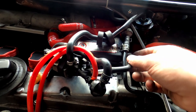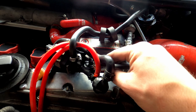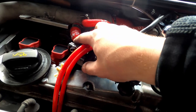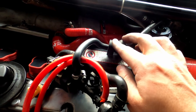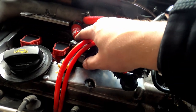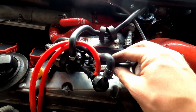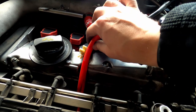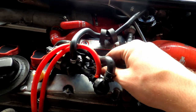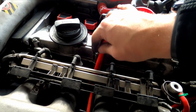If your vacuum leak here is sizable, you'll also consistently have a lower idle vacuum reading. That reading may jump around a bit depending on how small the leak is. The TT has an N249 system which contains a vacuum reservoir — it's this little black box on top of the manifold. The job of this is to store vacuum pressure while it's not needed so it's available when you need it, such as when you first start the car, and to help the car build vacuum faster as you throw in the clutch. You know you have a problem near the vacuum reservoir if your car loses vacuum pressure overnight and doesn't have a good vacuum pressure when you first start it up. There are quite a few lines connected to the N249 system but they're really simple to replace if you happen to find a leak — they both end up going under the intake manifold and into the metal bracket in front of them. If you just feel around under the manifold they're really easy to find.